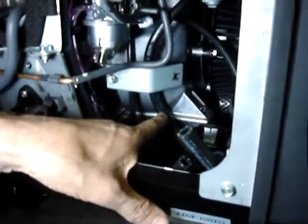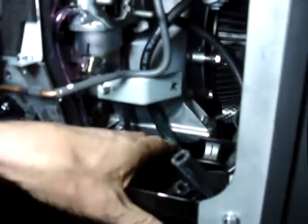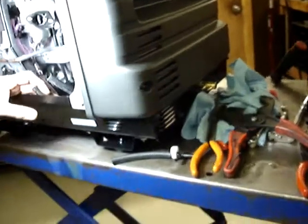The quarter hose that goes from the quarter to 3/16 adapter hidden behind this comes down, goes underneath the wiring harness, and is going to curve around and point towards the back of the generator. This is the quarter inch hose that goes to the connector in the front. It was routed under the motor mount.